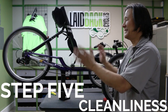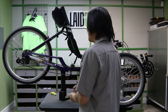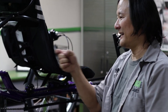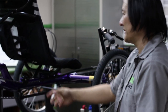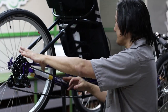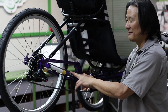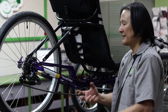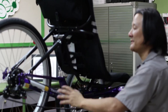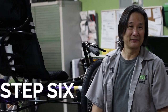And lastly, keep it clean. Wash the trike down with car washing detergent, a little bit of liquid soap, and warm water. Do not use a pressure washer, because it will leach the lubrication right out of the bearings and cause premature wear. Just wet it down with a rag or sponge — same as you'd use to wash your car — then rinse it all off and that will do fine.